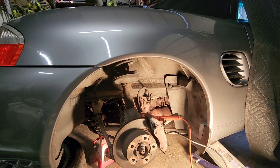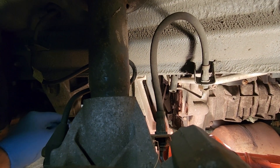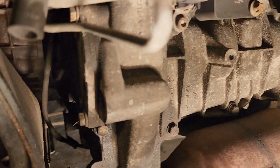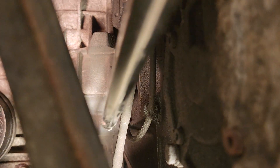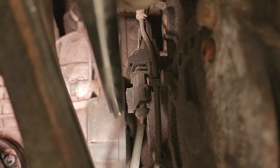We're looking at the right rear passenger side wheel well here. Take the wheel off, look at the brake caliper here, right above it. I'm going to come in and look deep into that hole there. There is a little wiring harness here that you're going to have to unclip. Right behind there you're going to find the sensor. You see these two wires here — one here and one here. This one is going up behind there to that crankshaft position sensor. I'm going to take the bracket off that's holding these two wires in and then try to get that sensor out.